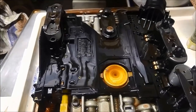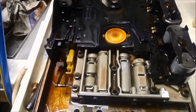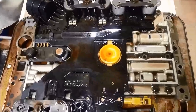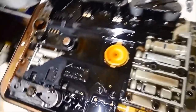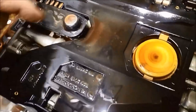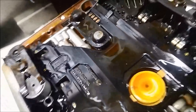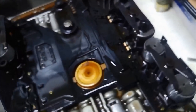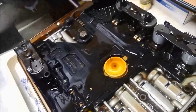I've got the conductor plate off the valve body. I've got an older video that actually explains how we did that and what solenoids do what on these. You can see the sensors there — they've got a fair bit of metallic debris on them, and this one's actually a little bit worn. There's a float sensor there. It's worth flushing those out if you can, but usually the problem is in this conductor plate — these little things wear out and then they give you trouble.